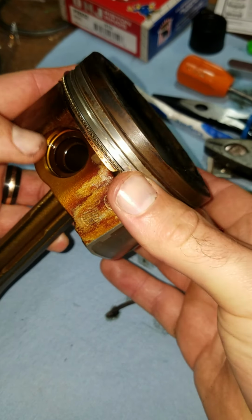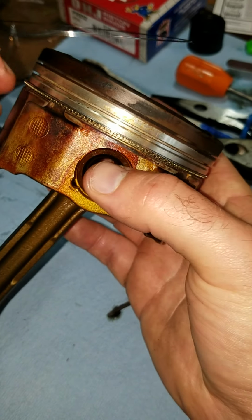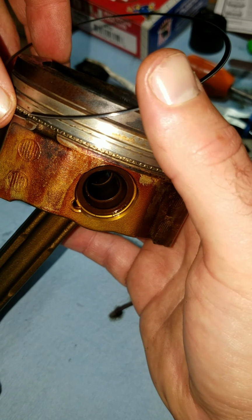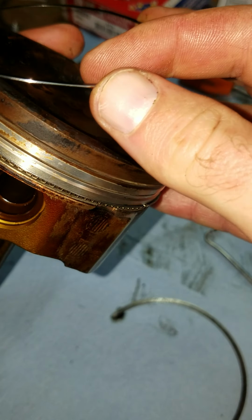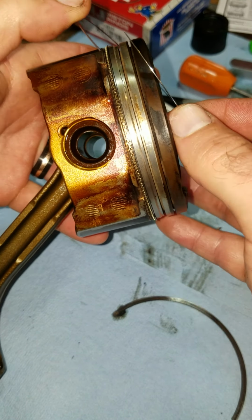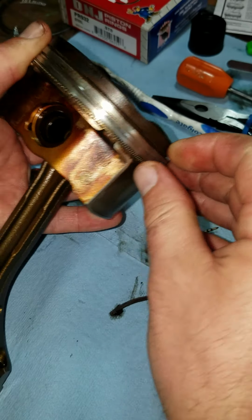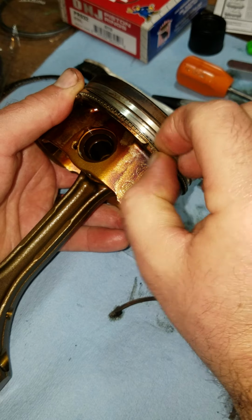Okay. And then the same with the third. You're going to off-center it the other way. And from the bottom, 1 or 2 inches to the left, get under the oil ring. And these don't necessarily have a top or bottom position. Just get it underneath, slide it around. Make sure it's on the bottom side.